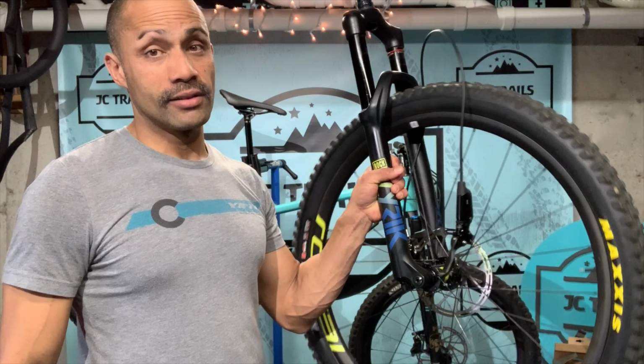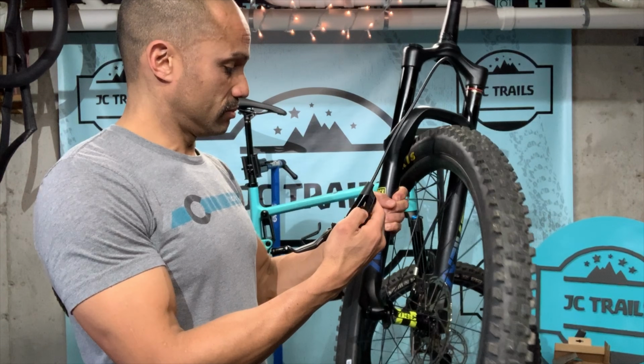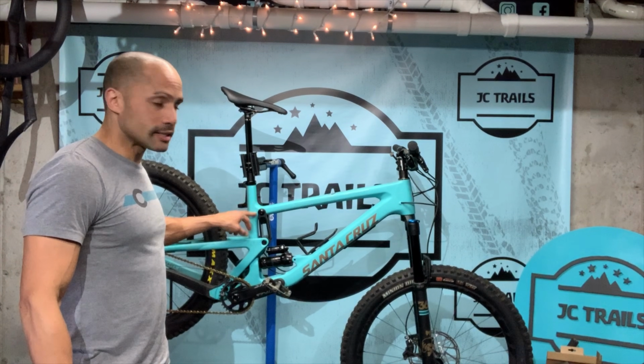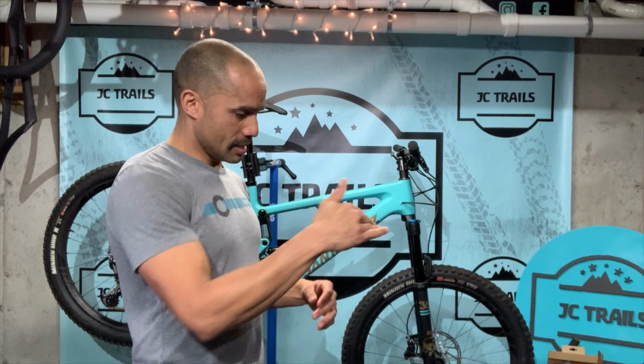It's kind of fun. All right, guys, welcome back to the bike basement, and let's talk about how this 29er front end affected my Bronson. On the climbs, the bike didn't feel as energetic with the seat tube angle 1 degree slacker. It felt a little bit lazier. I was back more on the back wheel, and the pedal efficiency wasn't as high. Also in tight cutbacks while I was climbing, just to get that big front wheel around is a little bit more difficult. More like slow technical stuff, it's not really good at.